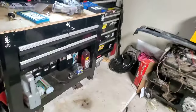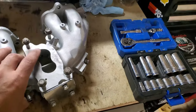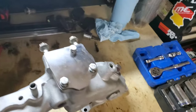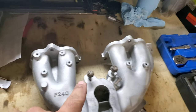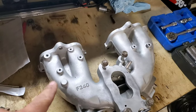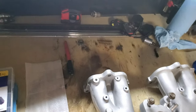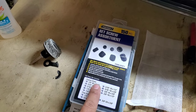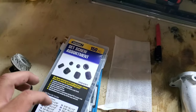This is the intake I've been working on. I sandblasted it too and made a little block-off plate for the EGR. I cut the vacuum lines — just like Mazda Mitch shows on his YouTube videos, I used his directions. And I drilled and tapped with his recommendations. Some of the taps he said to use we didn't have, so I used a tap I had for the set screws, but it was still the same drill size that he used.